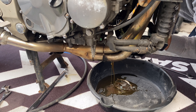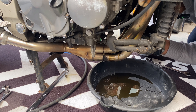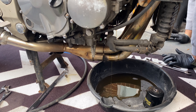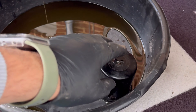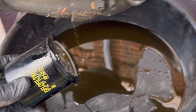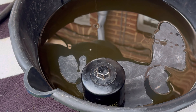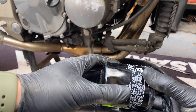It's actually quite clean oil - really clean. But it absolutely stinks of petrol. If I had smell-a-vision you'd be able to smell the petrol in this. I don't think it's as clean as I thought it was either. It absolutely stinks of petrol - it's disgusting. I like to smell petrol, but it's not meant to be smelling of petrol in the oil. We'll let that drain for a little bit.